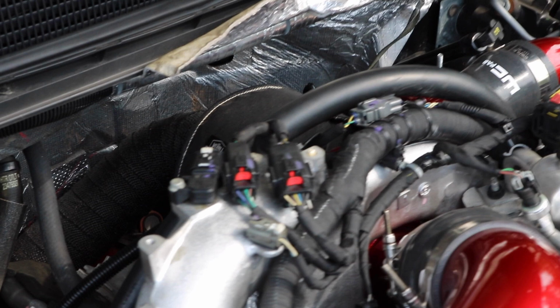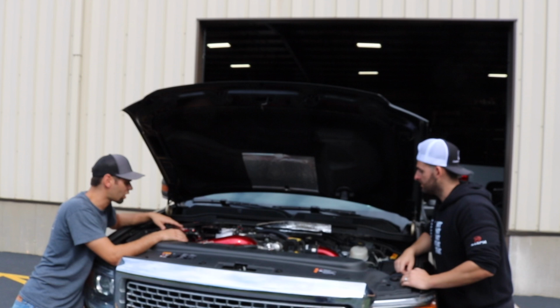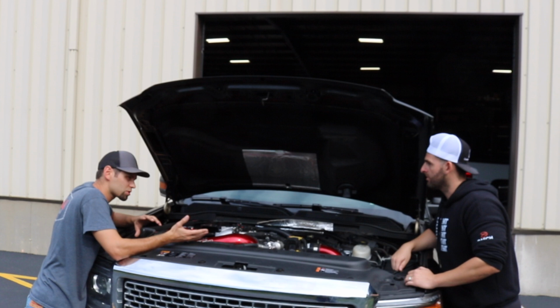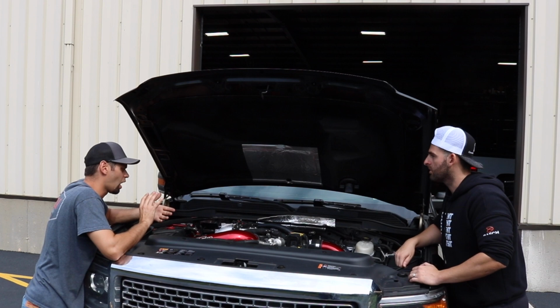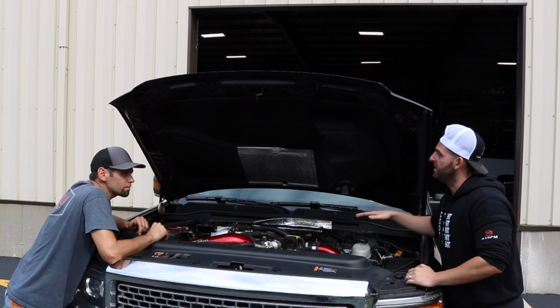It's compatible with your existing intercooler pipes that you already had. It's compatible with your existing intake. Comes with a new downpipe, oil lines, adapter, all the hardware, new turbo mouthpiece, the new intake horn, and then the turbo itself, it's not your standard off-the-shelf S300 turbo. We've done some modifications to the compressor cover to allow us to incorporate some of the OEM sensors and other OEM components and allow it to drop in and use either an OEM intercooler pipe or our upgraded intercooler pipe. So people can put this in with the OEM piping.